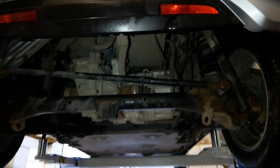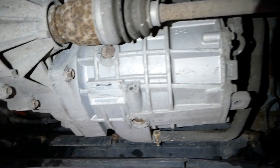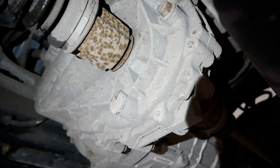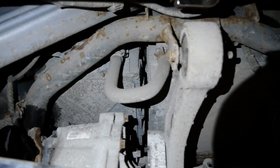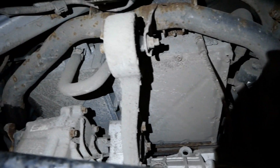It pumps water around the electric motor and around the base of these units to take away all of the heat. If we look underneath the car, we can see the electric motor, and the drive comes through this little single-speed final-drive gearbox. Then we've got our two little shafts driving the rear wheels, and up there we can see the two units — all the electronics, the charger, and the inverter systems.